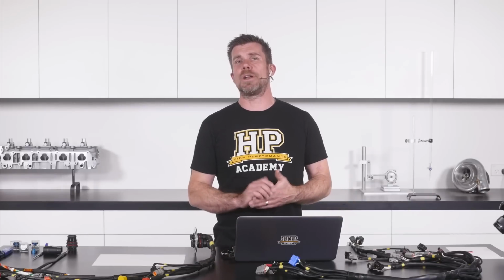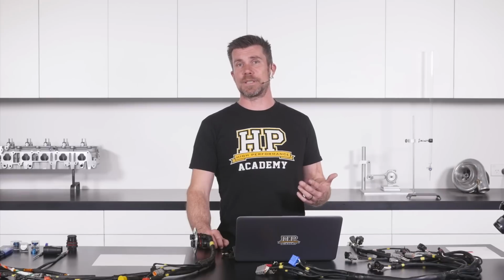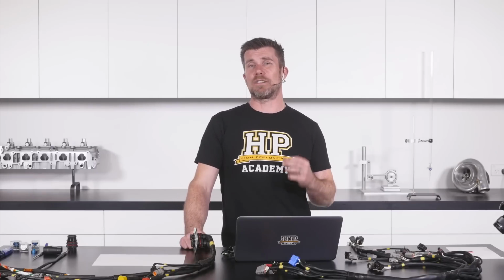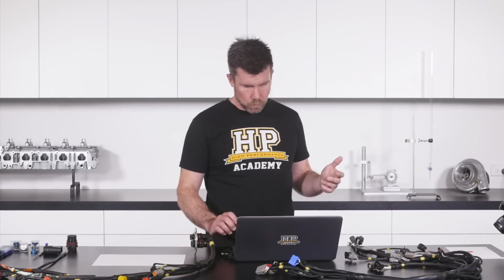At the same time, we also have just received our new Driveshaft Shop 1,000 horsepower rear axles. Probably overkill for what we're doing at the moment, but this will future-proof the car for what we've got planned. Now, the limitation with the factory hubs in terms of how big we can go on the drive shafts, or the CVs, is really the size of the wheel bearing and where it goes through the hub. So it limits the drive flange size, which in turn limits the outside diameter of the spline. So basically with 1,000 horsepower axles, Driveshaft Shop go to the trouble of supplying a complete new hub assembly, a bigger wheel bearing and a bigger drive flange. So those will be going into the car as well.